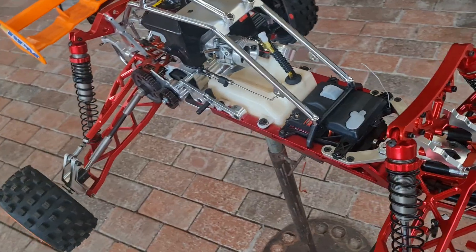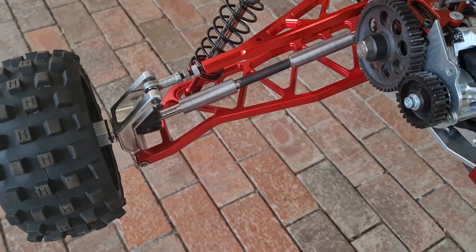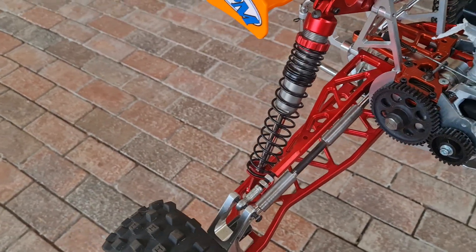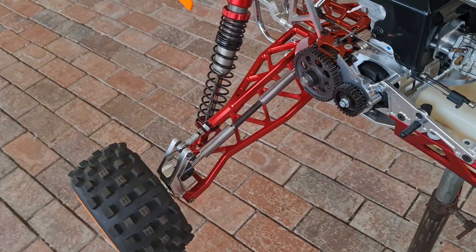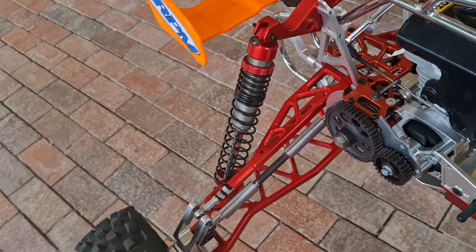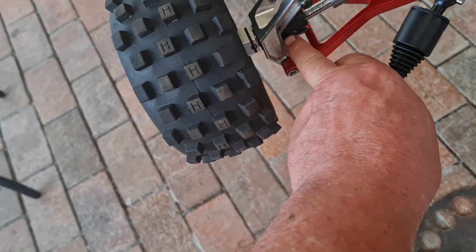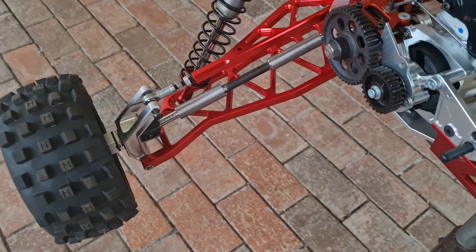I'm basically building it up to suit the torque. The dog bone shaft I've got in there I actually modified — it's got the SC bigger ball with the bigger pin, and I did it two mil shorter than the stock one that comes with the swing arm. Actually I need to go shorter by three to four mil. Unless I put much into the strap, it's just binding up there, as the machine is a bit further back.